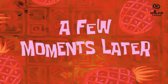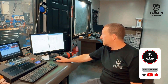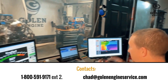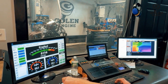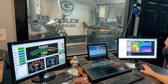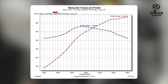A few moments later. I'm going to add one degree of timing, so we'll go up to 27 degrees and see if we can coax it to make just a little bit more than last time, which was 631.9 — let's call it 632 horsepower. Let's go after it and see what she does. Not a lot — it didn't do much, but that's max power, so we made just a little bit more, not a ton.